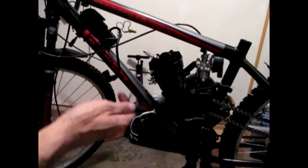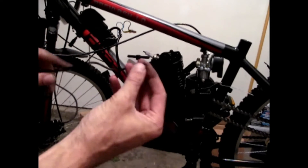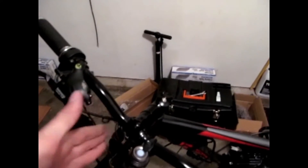Here's the kill switch — we're going to have to strip the wires down and everything else. This is like size 18 to 20 gauge wire. I'm going to strap this to the front. When I strap them I just strap them as close as I can and follow the neck of the frame down. You want to make sure there's enough slack so if you're taking a right-hand turn you won't have a problem, but if you have a left-hand turn you don't want too little slack.